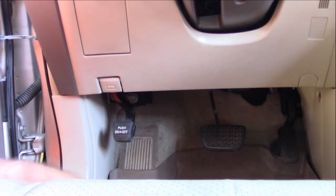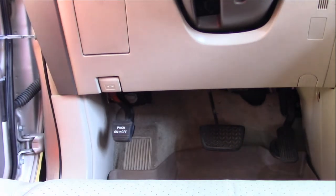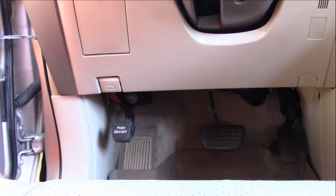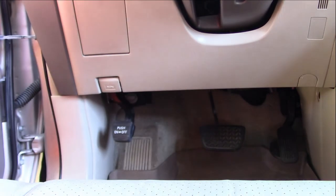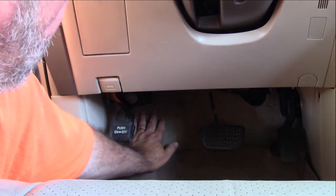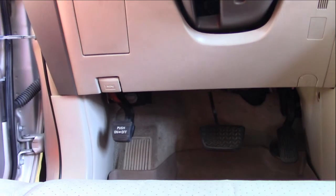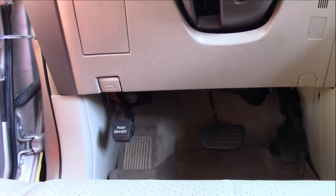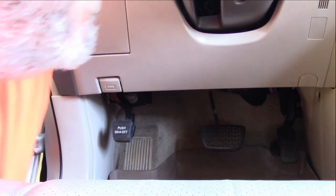All together. The emergency brake is now nice and stiff and it's not riding. We just finger-tightened it and it got nice and snug just by doing that. Now we have a functioning emergency brake — where it used to go all the way down to the floor, it no longer does. It looks pretty solid. It's all back in place. Pretty simple — probably take you about 10 minutes if you work fast. That's how you adjust the emergency brake.